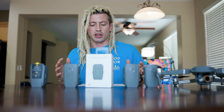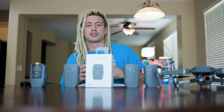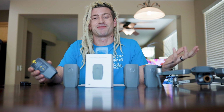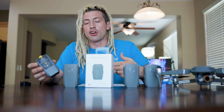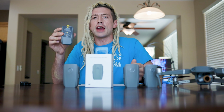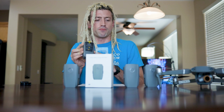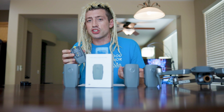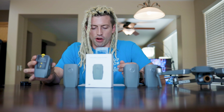There's a few other things you can do to help maintain your batteries. One of them is, with a lithium polymer battery, you typically want to keep it between 20 and 80% to maintain its health. When I first bought my drone, these things would just stay charged for a long time. But about a year ago, they started adding an auto discharge feature to the batteries through an update, because they are intelligent batteries. They self-balance inside when they charge, and now they even discharge themselves. So they're very advanced. That's why they cost as much as they do.